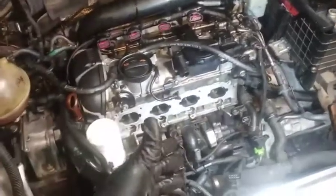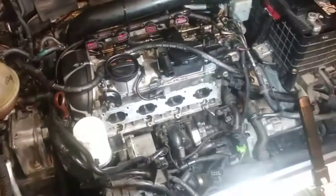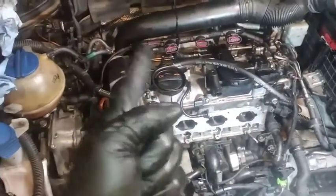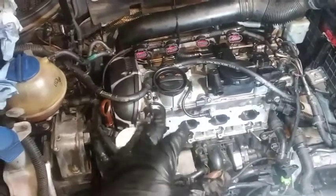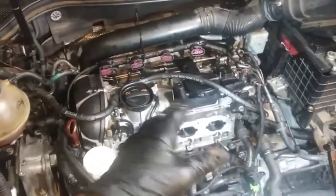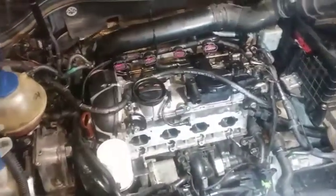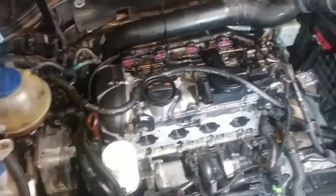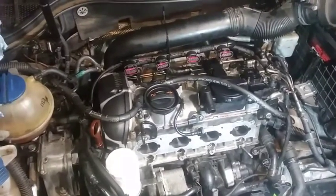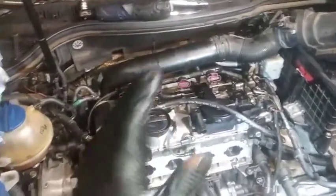I'm going to be straight up - I didn't use a torque wrench. I tried to but I couldn't really get down to nine newton-meters and do a quarter turn. Some of those fasteners I didn't feel comfortable torquing beyond what felt comfortable. But from experience redoing motors, I'm sure I'm fine - I snugged them all down. Even though some of them felt like they were stretching and I did not buy any new ones, we'll see how they work out. These are pretty heavy bolts, feel like grade eight fasteners.